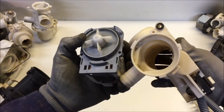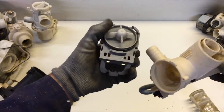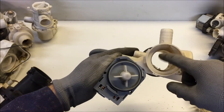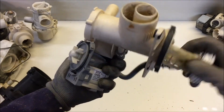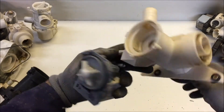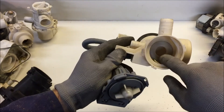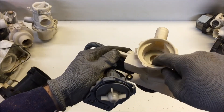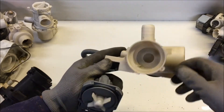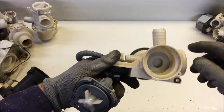And there's an o-ring seal, and there's the housing and the impeller blade. All the impeller does is spin either way and it forces the water up this hole here. So when the filter plug is in place, it makes this little inlet here, and that's the outlet. So water is present here and gets pushed up this way, out the grey hose on the back of the washing machine, or around the recirculating hose.